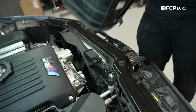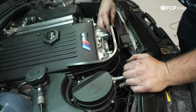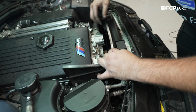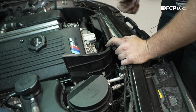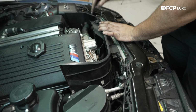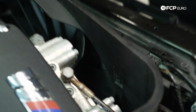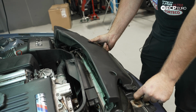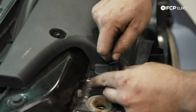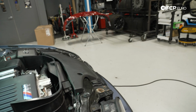Next up, we have this secondary fan shroud we need to install. It secures in place with a little notch that it slides in onto the main fan shroud. And then we have an expanding rivet here and an expanding rivet here that we need to push in. Those are the shallower ones. Next up, we'll reinstall the suction hood here for the intake. These are the longer expanding rivets. We're all done up top.